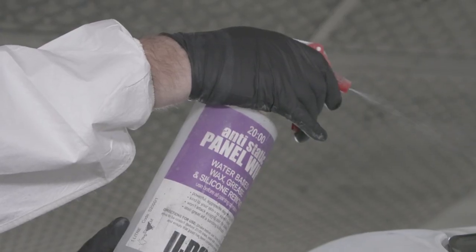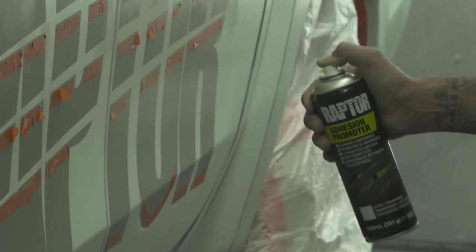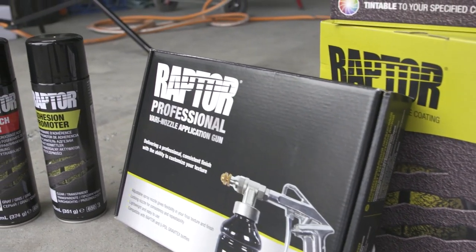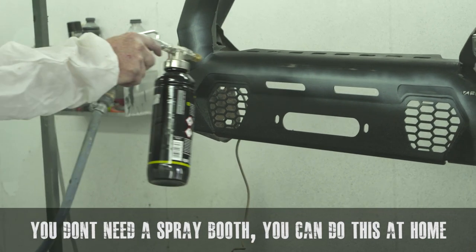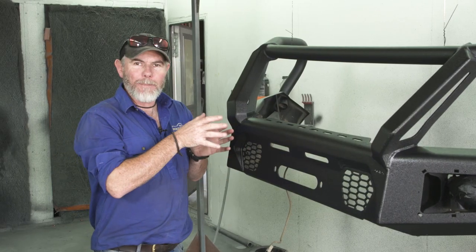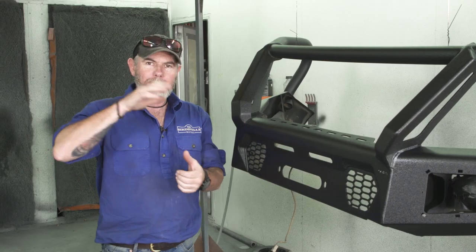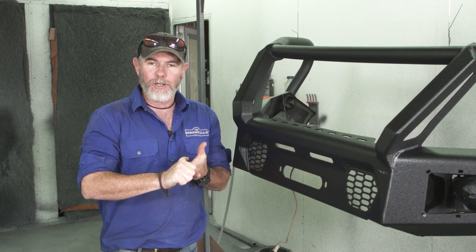Clean the surface with a water-based cleaner, spray on the Raptor adhesive promoter, and you're ready to paint. To do a bar like this you're only going to need a one-litre bottle of Raptor, or two of the Raptor aerosol cans. You'll also need the applicator gun that screws onto your bottle. It's best to do two coats on your bar work, leaving an hour between coats. Have a look at that — it's come up brand spanking new! And it's not just bar work — Shauno has also done the inside of his tray on his 79, and also the chassis on the Dirty 30.